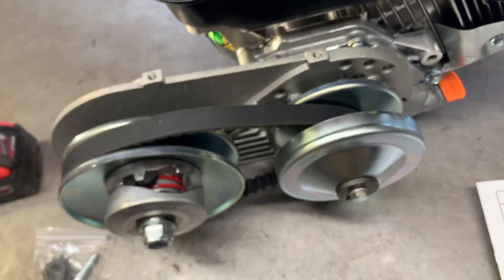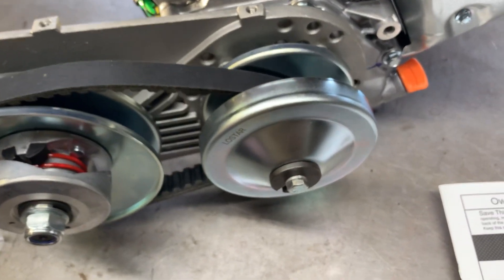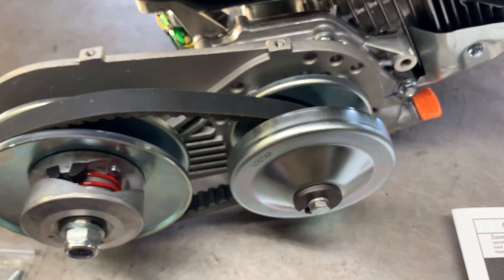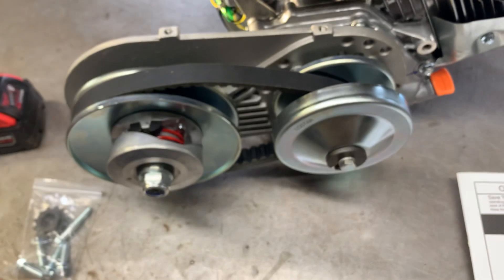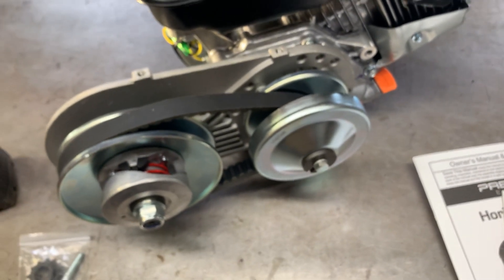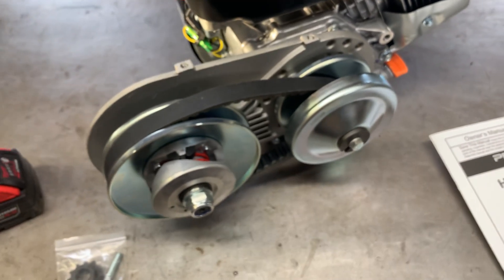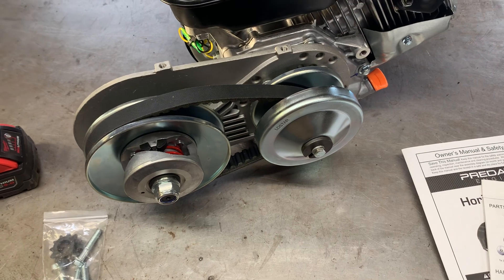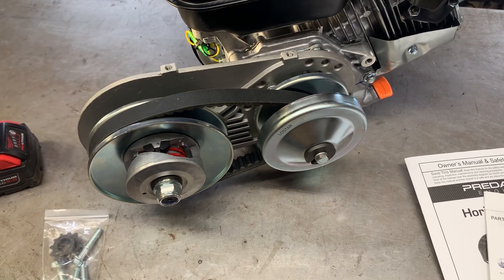So that's what you need for the mounting bolts — one for the crankshaft and a little Loctite for extra insurance that it's not going to come loose. The thing does spin and vibrate, and you don't want it coming apart while you're driving. Hopefully that was helpful. Make sure to subscribe for more helpful tips. Thanks, bye.